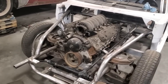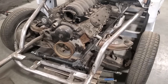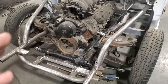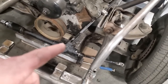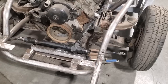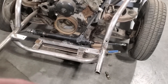I made short order of that. I've been sitting down here playing around with this, sizing things up. I have a whole bunch of problems going on here — this is one of those things when you come across projects like this. One of the dilemmas I had was figuring out this rack and pinion. I have it all figured out now about how to narrow it. The problem I never could see in my head was this angle here, how all this was going to work with the universal and stuff like that. You had to have it mounted to size all that up. Here's part of the dilemma: this rack and pinion I got here was modified before for a hot rod — the end was machined off and re-threaded — and this unit is too short for this car. I went online, looked one up, and ordered one. That should be here next week or so.